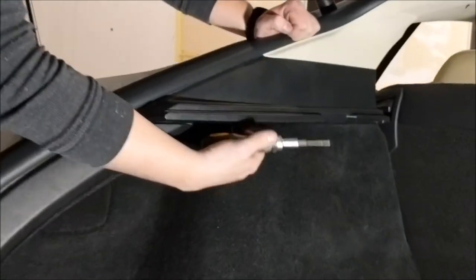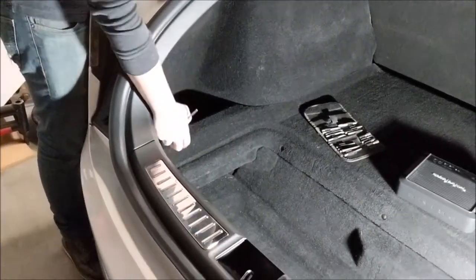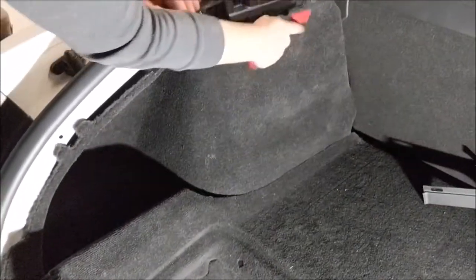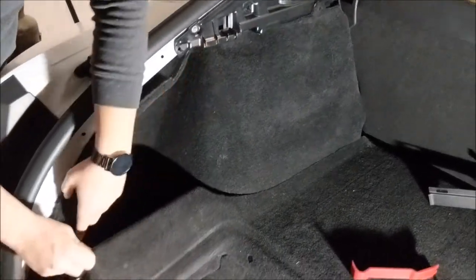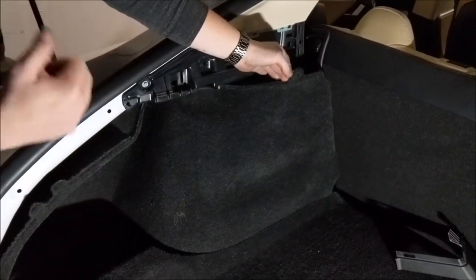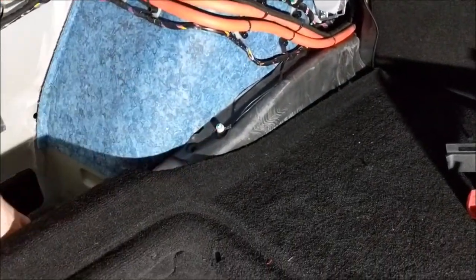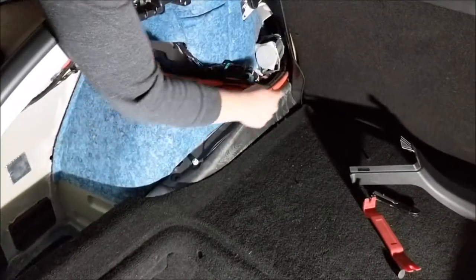Now let's start taking the panels apart for the wiring. First, this trim piece has a Torx 20 bit underneath that we're going to remove, then this piece can go outwards — it's held in by clips. Then you're going to move to the carpet where you have carpet plugs that just come straight out. Now that we have those trim panels removed, we can go ahead and start moving the carpeting. This piece of carpet has one more plug to remove. Be careful — these also have lights in them that you have to disconnect before you can pull the carpet out. If you're installing the amp in the back, we recommend this as one of the better ground points. We're going to route our wiring along these bundles underneath and moving forward.